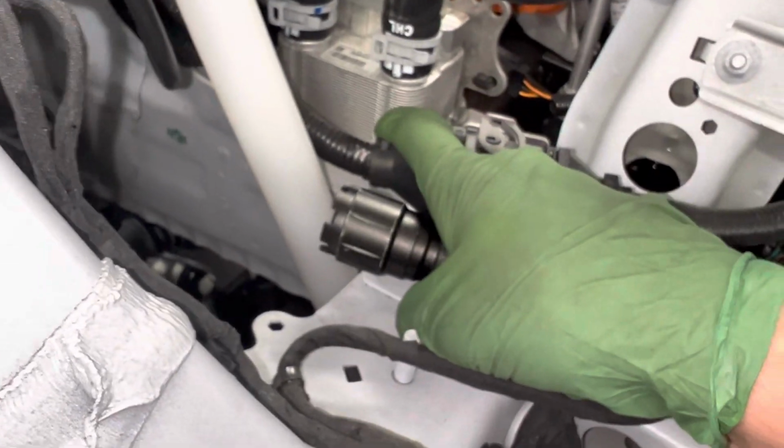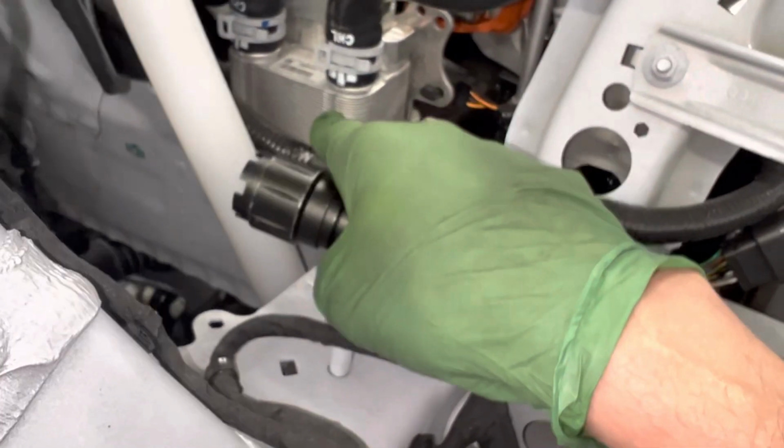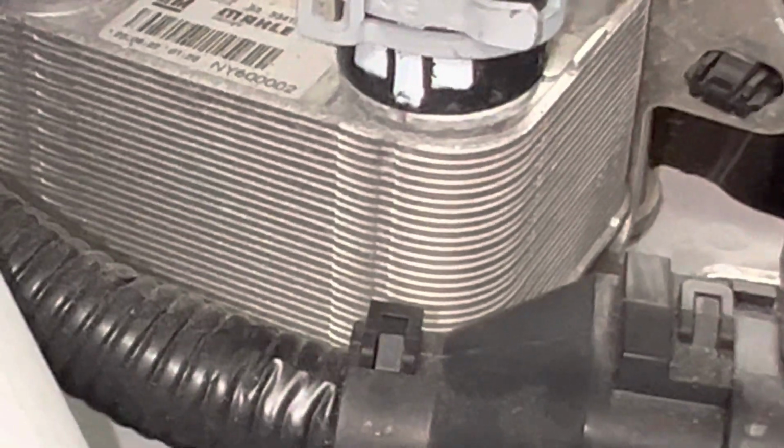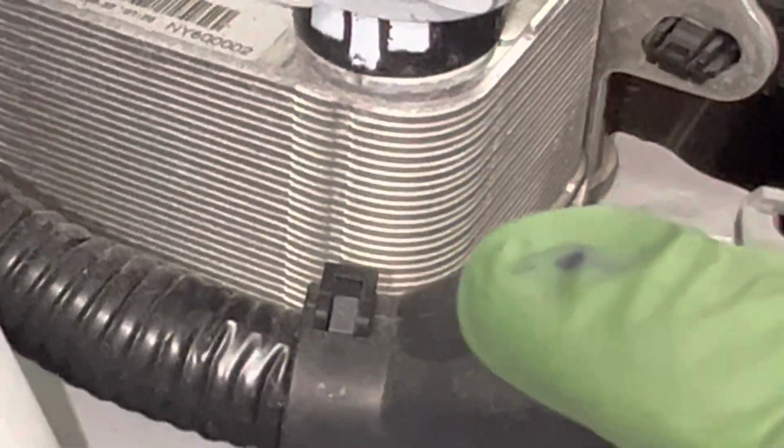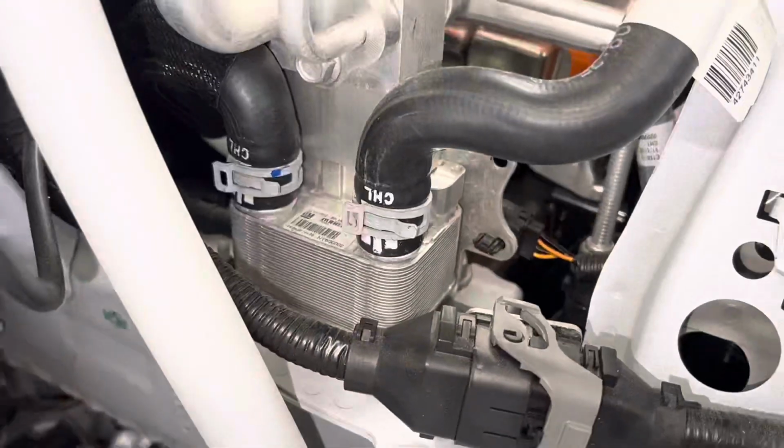Go on Google and look up plate heat exchanger and look at construction of plate heat exchanger. You might Google those search terms so you can see how these are manufactured inside, how every one of those little tiny lines, you see those little layers in there like rings on a tree? So in between, cold refrigerant is traveling in one direction. But then hot coolant comes down, and on the next line, hot coolant is going in the other direction, and it's getting cooled by the refrigerant, and then it comes out cooled going out the other direction. So it's exchanging the heat. The refrigerant is absorbing the heat from the hot coolant, cooling it down so it can recirculate and go back into the system. That's how this is working.